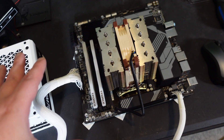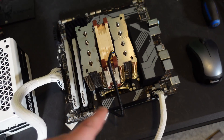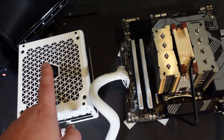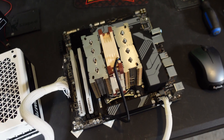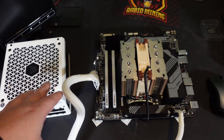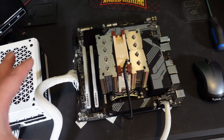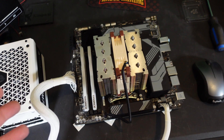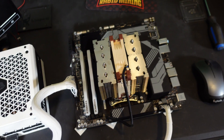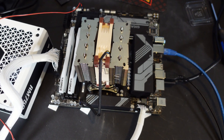When I get the second rig in — identical to this one — I'll bring in another CPU power cable, and then run 24-pin splitters to power both rigs off this one power supply. That's for another video. For now we're ready to roll. I need to plug in a power switch since we haven't done any BIOS settings yet, so it won't turn on by itself — but I'm going to try it and see.